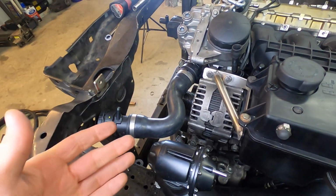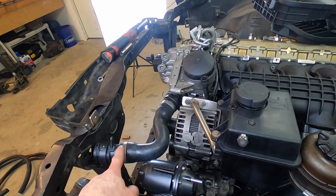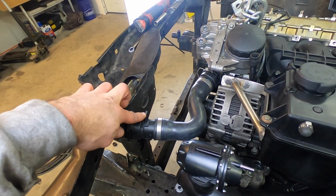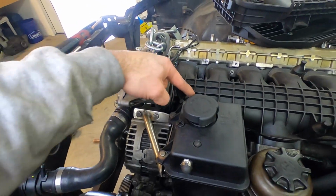It's not good. So we've got to figure out how to modify this upper radiator hose next in order to make it fit, not only on the actual upper radiator itself, but also this guy, which will not be included here because it's already on the radiator, will then snake around and go to the top of the coolant reservoir. So I need to get a couple of parts from the store. I'm going to do that another time. I'm not going to inundate you with the details of how to put a three-way T in at the bottom and connect it to the bottom of the reservoir, but that's how you do it. It's going to be tight in there, but it should work.